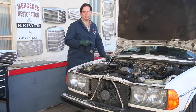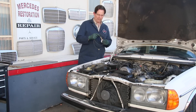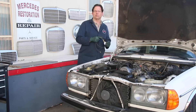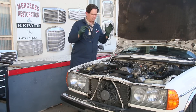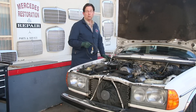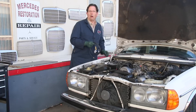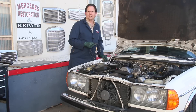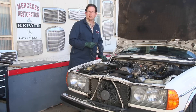It's not difficult to do this and it really does narrow down the problem rather quickly. For instance, if I would have taken this out on the road and only seen maybe one or two pounds or zero pounds of boost pressure, then I'd know it was my turbocharger causing the lack of power. And of course if it's boosting more than nine or ten pounds, then something's wrong with the wastegate - it's not opening up, and you don't want to be overboosting the diesel engine or you'll damage it. So this is a real good test.